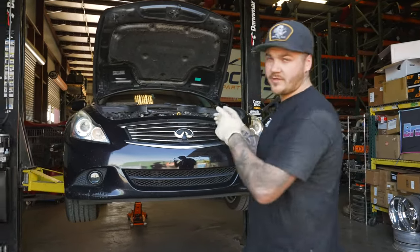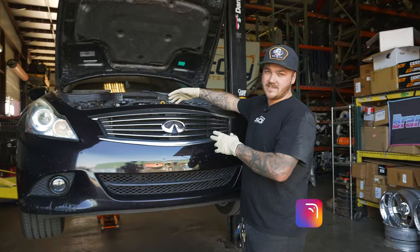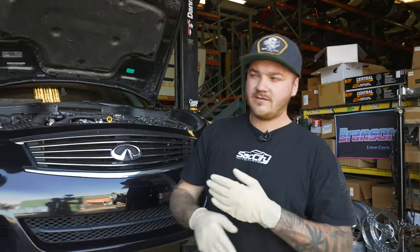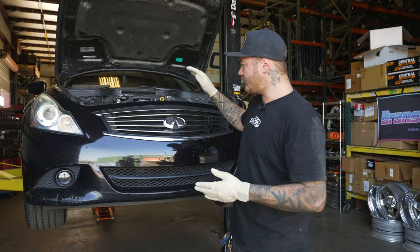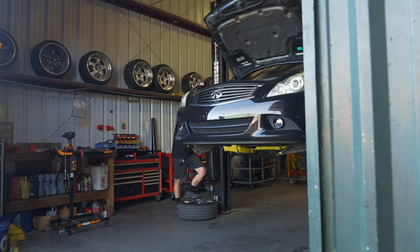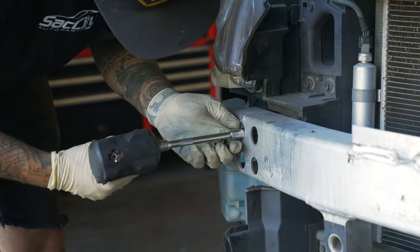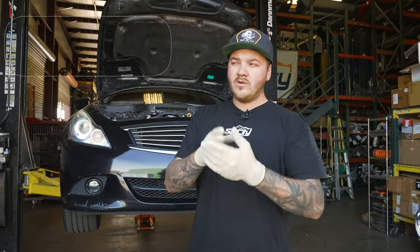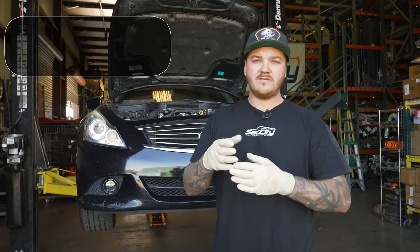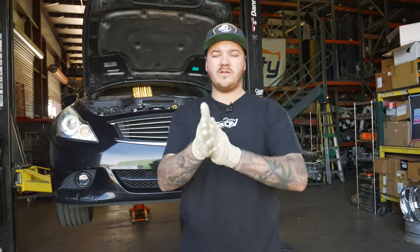First things first, when you're doing a gallery gasket job there are two ways to do it. You can either leave the front end on and work in that little space — you have to take the radiator out, coolant hoses, intakes, and the coolant box. If you've done it a ton of times and feel comfortable working in that small of a space you can do that. But on this one we're going to take the whole front end apart — headlights off, core support off, flip the AC condenser over, pull the radiator off so we can see all in there. I like doing it that second option because when you get all that out you don't want to get the car back together and then have a leak somewhere or didn't clean something good enough. So we're going to show you that way today.